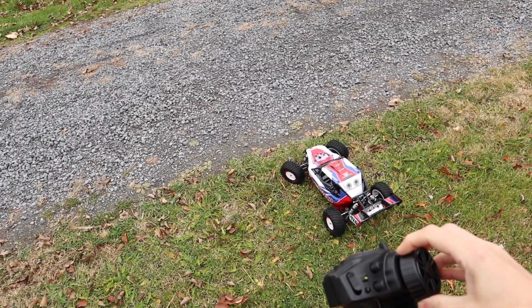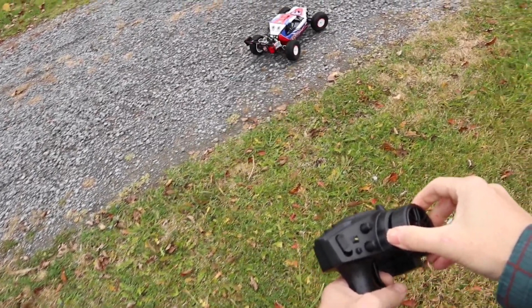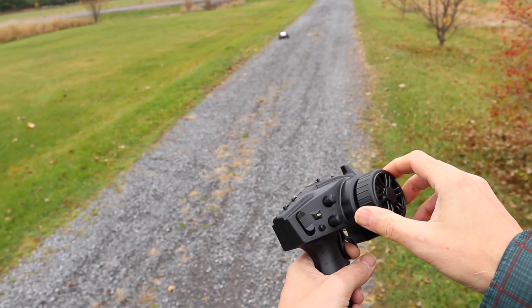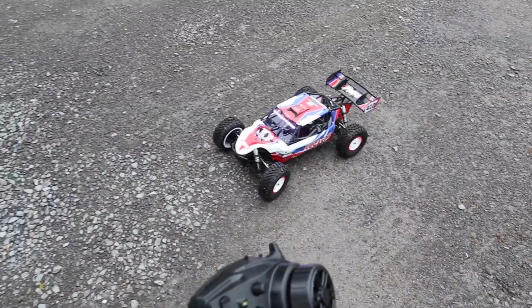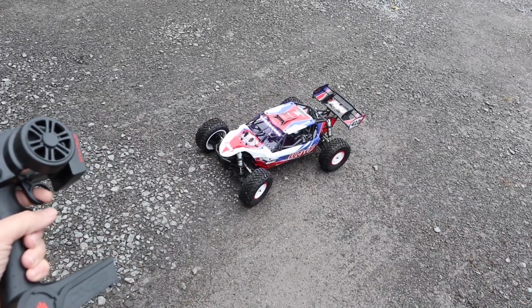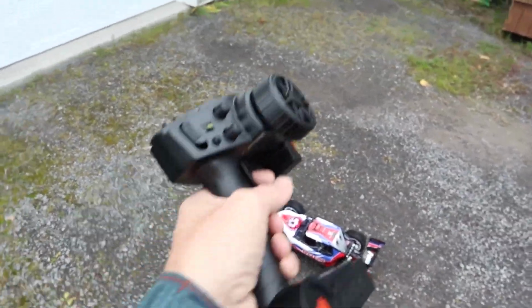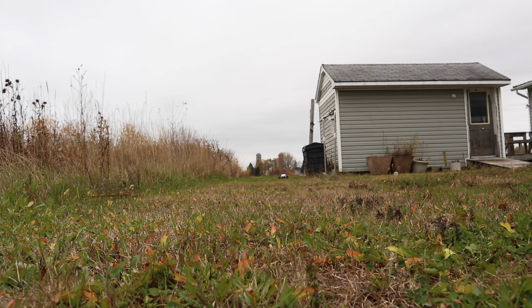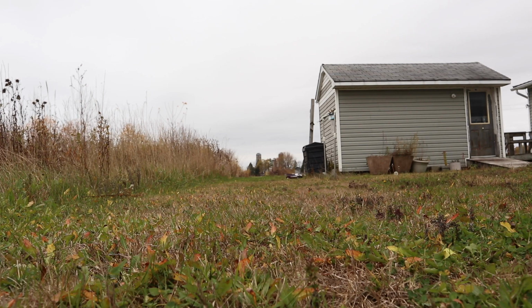First impressions is that the steering is very weak in that bell crank system. I do need to tighten that up. It seems very loose, as it does pull the vehicle kind of aside as you run it. Again, tracking is straight, but this is on that weird receiver where it auto calibrates every time. It is a sensorless system, so at slow speed throttle it does cog a bit if you go really slow until you get rolling. So that's just something to be aware of. There's a bit of a grinding noise happening, which is weird because I did check.